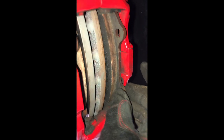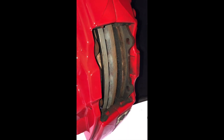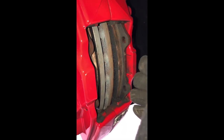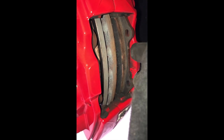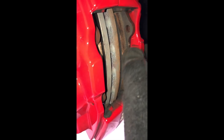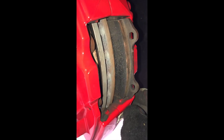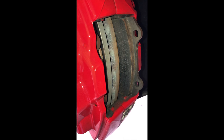You can see the pistons in the caliper are pushed in nicely. Here's the thing: when you take your new pads and go to put them in, they're going to go back in the same way these ones come out. If you don't do this often, I would recommend you leave the old ones in until you get the new ones so you know how to orient them. If the new pads hit those pistons in the caliper, put the old ones back in to create play, do more hard pushing — and if that doesn't work, hit it really hard and sooner or later you'll get enough play to put the new pads in.